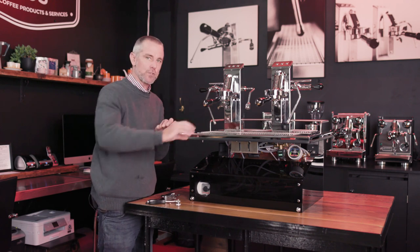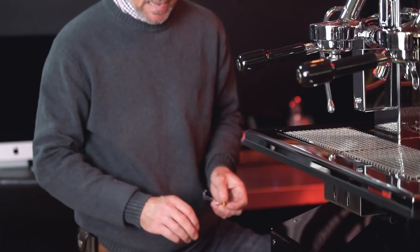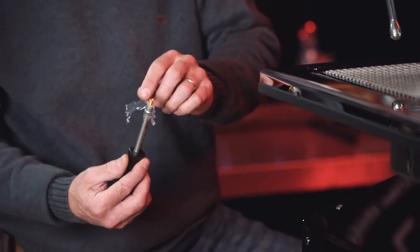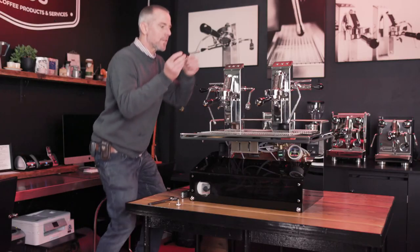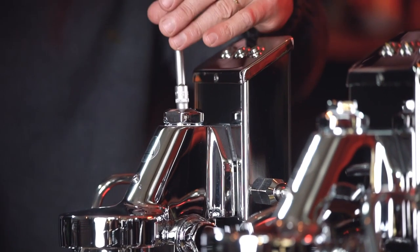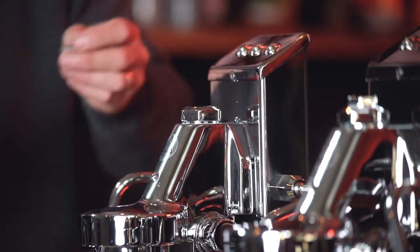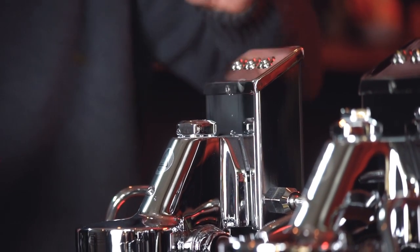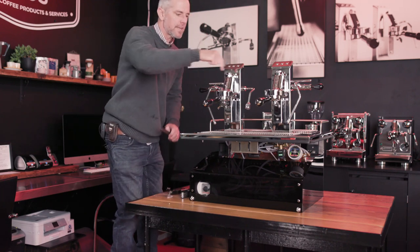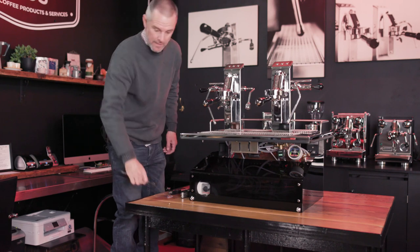All of the water that flows through your coffee needs to pass through that tiny little hole, so you can appreciate how easily it can get blocked. To put the jet back in — this sounds a little dodgy, but so it doesn't fall out of my socket, I just put a little bit of plastic to wedge it in so that I can put it into position and screw it in. Then I remove the plastic and finish tightening the jet — nice and firm. Then the filter goes back in over the top of the jet, making sure it's upright, and carefully place that in over the top. Screw that down. The Teflon gasket works many times, so we don't need too much pressure — just nip it up is all that's required.